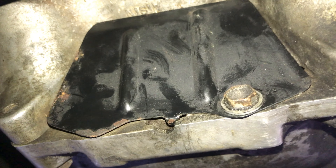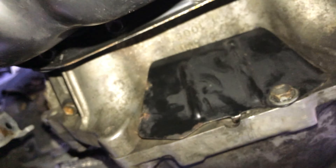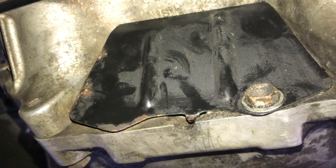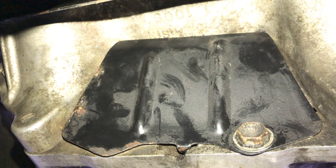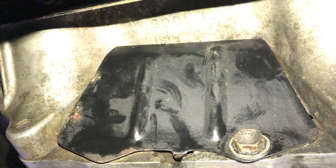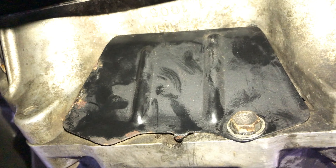I got done putting on the flywheel torque converter bolts, and now there's this cover plate here. It only has one bolt even though there is another bolt hole. Maybe I need a new plate — it does have some rubber edges that mine doesn't have. If you're going off-roading, even getting up to the center of the wheels, if this isn't sealed you're gonna get water inside your bell housing, possibly mud or sand to grind around on the flywheel. Not sure what the definite fix is, or if guys doing water crossings seal this up or leave it open for condensation.